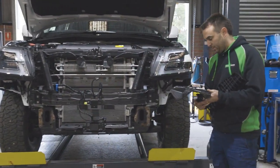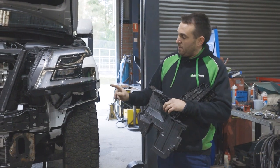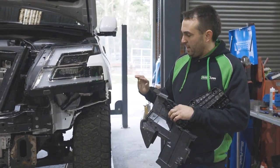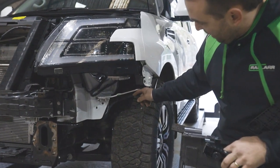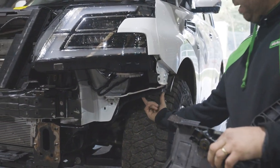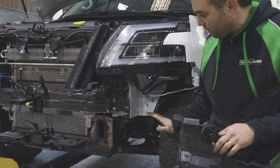The little side clips, which are here, have got to be unbolted and removed. Some people like to paint that bit black so you don't see it from behind the bar. We've trimmed the guard liners off. We try and go 20mm down from this bracket. The only important area is here. The rest you just do neatly, follow the body line so it's all nice and tidy.